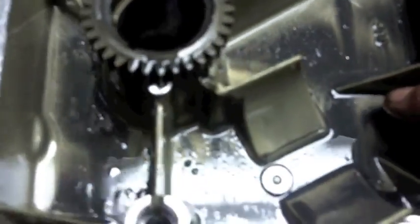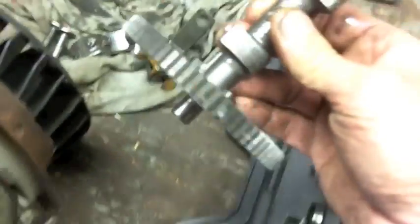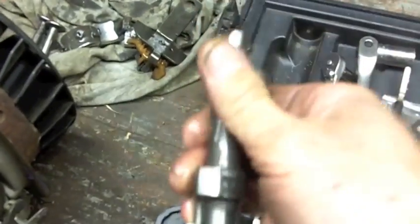The base plate — none of the strengthening fins are bad. Nothing is gouged, nothing is blown out, all the surfaces appear good. The oil pump appears good, the cam gear looks good.